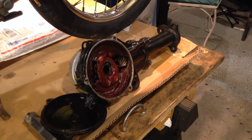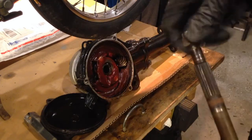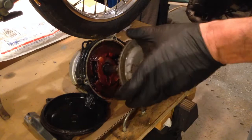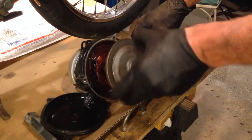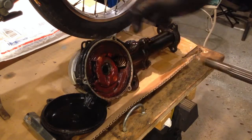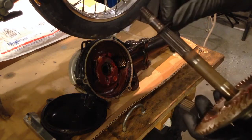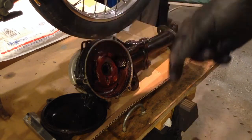Which is no big deal. You can kind of see the greasy mess in there. I've got the ring gear already out, and I'll take this off. This is actually off a Honda Express — I don't think it came with an axle nut. The ring gear just, if I can line up the splines — which for some reason I can't — but this goes all the way in and you basically push it out from the other side. One thing you want to keep track of is this little washer spacer that goes on the back side, so don't lose that because you'll need that later.